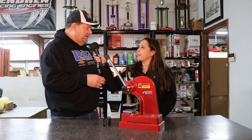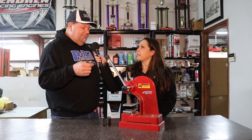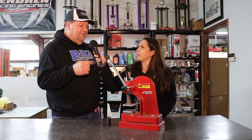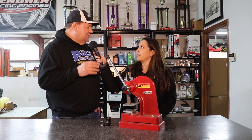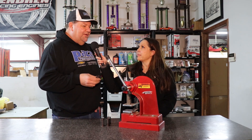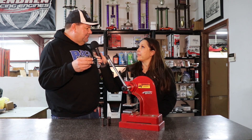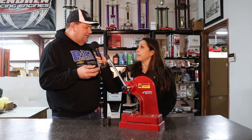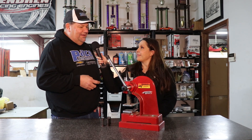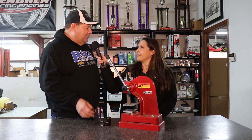Some shops do it differently, but the same basic process. I check them at two points and then match them, because in all my years of building open racing engines and crate stuff, you need to control that valve motion when it changes direction as it goes over the max lift of the camshaft and starts down the back side of the cam. If you have a spring that's weak there, the lifter is going to leave the camshaft, start harmonics, and once it starts floating, it's over until you stop the engine and restart it.